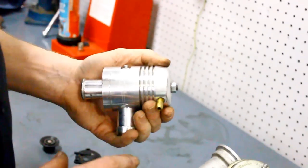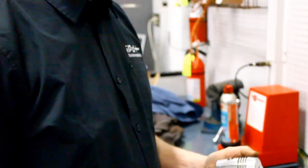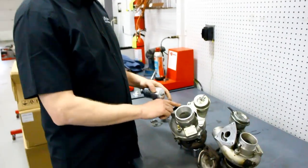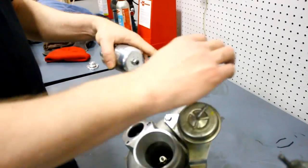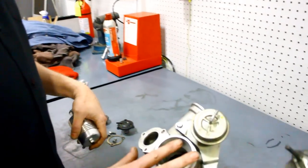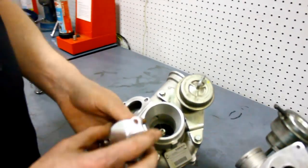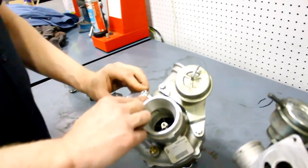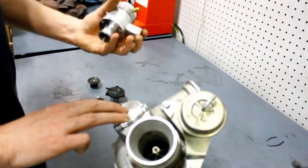This is one of our HD external CBVs, and we began playing with these because we're working on a Stage 3 turbo of our own. There's just no way to control the boost in those higher output turbos with a compressor bypass built in like this. So instead of using a built-in unit on our Stage 3 kits, we'll simply move the bypass to where it's completely external — picking up one at the output and dropping back in right before the input. For cars with a built-in bypass, if you want to use an external one, we've made a block-off plate with O-rings that bolts in using the stock bolts to completely disable the factory bypass.